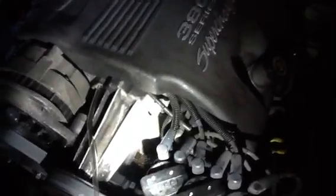You don't need to take this whole cover off, which I actually had a problem with. I unscrewed that guy, but then there's this little screw in the side. I really don't think you could see it with this, but it's this tiny, tiny little hex screw right there, and my tiniest, skinniest one would not get in there to unscrew that, so I was unable to take this cover off. But you don't need to. I was able to get the hex screw in there, no problem, with this cover on. So there's no question you could do it as simply as this. Just unscrew that bolt, siphon it out, and put the clean stuff in. So anyways, I'm going to get going here, and I'm going to complete my task.